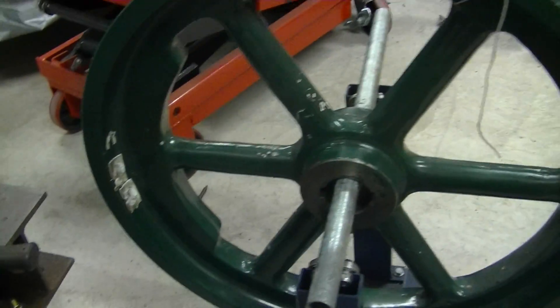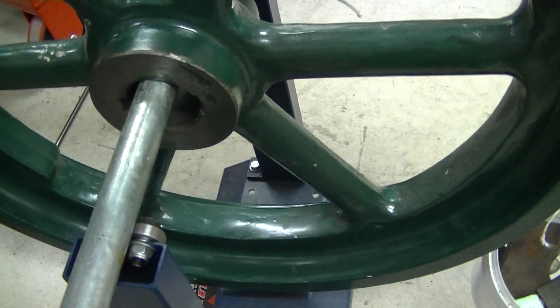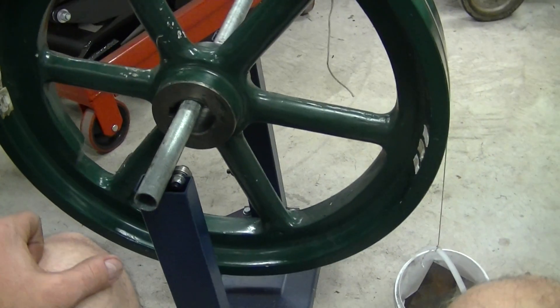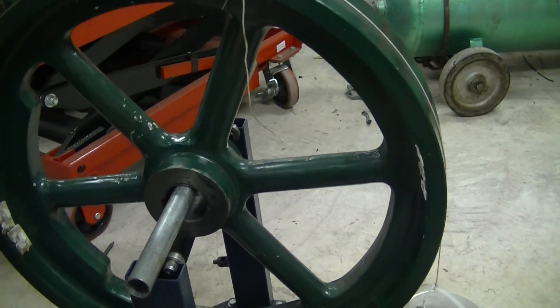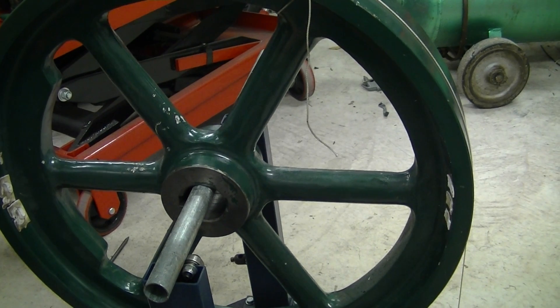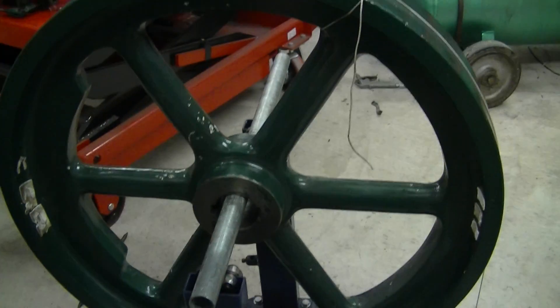This one here is actually quite a bit heavier. I've got a motorbike balancing stand, and I'm just rocking it backwards and forwards until that weight there becomes horizontal. I've pretty much found the weight required to be able to do that — it's gone fairly horizontal. The amount of tension required to actually modify that is very low, so I think it's pretty accurate.